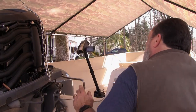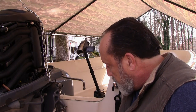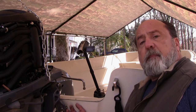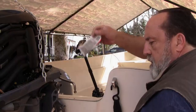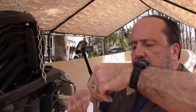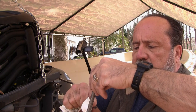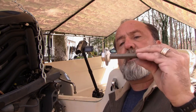We've got sealing on the inside for the top two bolts. Next step is to get the two bottom bolts in. I'm going to do the same thing — seal the inside, and I'll also give you a close-up of how I seal the outside. Here are the bolts for the bottom; we'll do this side first. Get a nice layer on there — basically I want enough to squeeze into the hole and up against the gel coat to seal that off as well as possible.